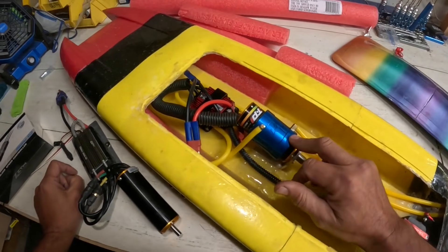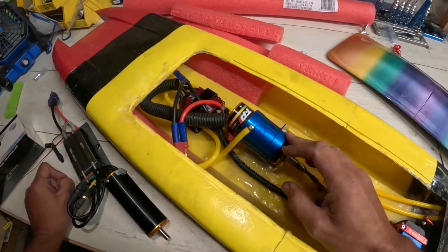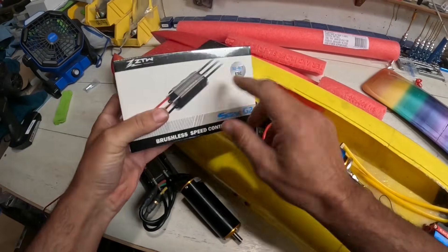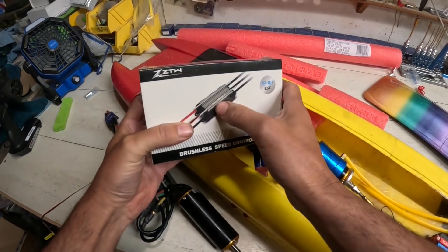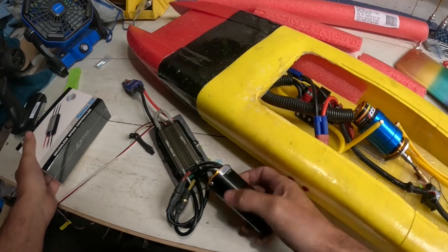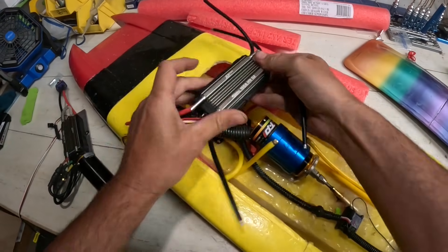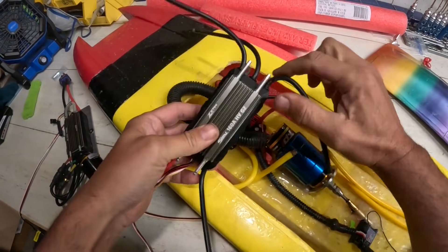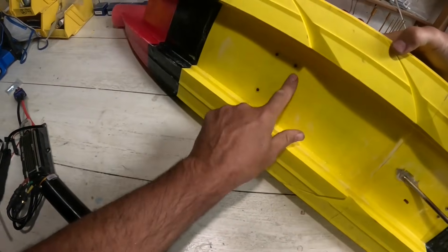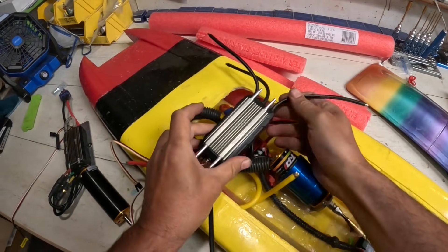Before I pull this motor out today, I'm going to give it one blast on 8S — which I don't like for 1600 kV, but it will work. To do that I've got to get rid of this 175-amp boat ESC and put a HV ZTW 160-amp in there. The ultimate goal with this motor is 12S and this will suit that, so that'll save me a job later swapping it out. I just need to find a way to hold this one in — I can just screw it down through there.